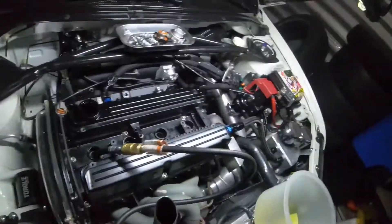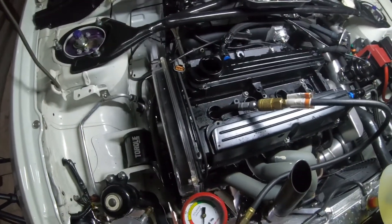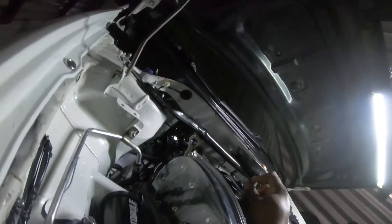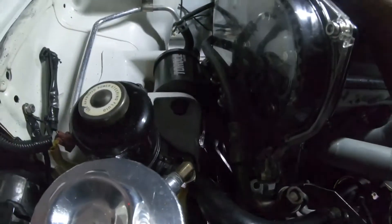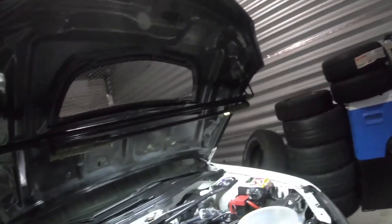It's leaking all the air out — that means this is not top dead center; the valves are open. Let's back this down, spin the motor over some more. Make sure you take out your spark plugs too, it makes spinning the crank so much easier. Two things can happen: this thing is gonna blow coolant all over me, or it'll show a load of bubbles which still means it's leaking. I know my rings will have some leak because the engine was built a little loose — my builder knew I was going to beat on this car.